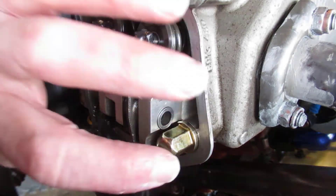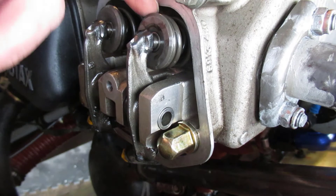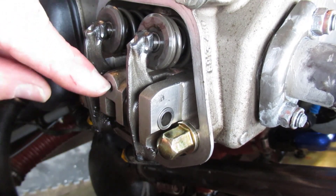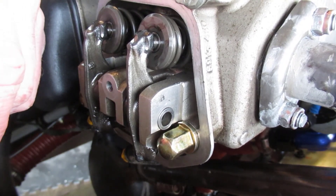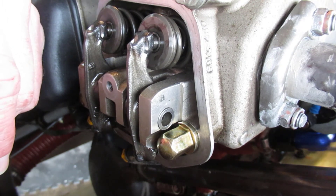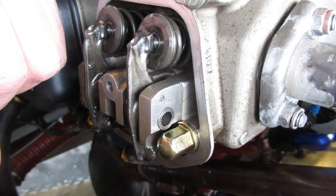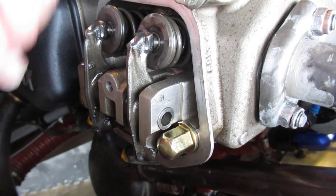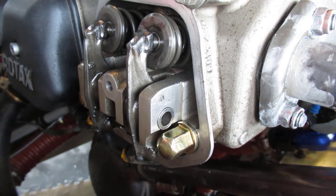You want to make sure that you get the rocker cover on securely and those O-rings in place, because if you're leaking here it's not just leaking oil — it's leaking pressure from the blow-by. And that pressure from the blow-by is what sends the oil from the crankcase back to the oil tank. You don't want all the oil pooling in the crankcase and running out of oil. So, assuming nothing goes wrong, that's the whole process for purging the oil system. I hope you found it somewhat useful or entertaining. Thanks for watching.